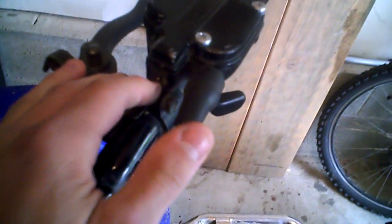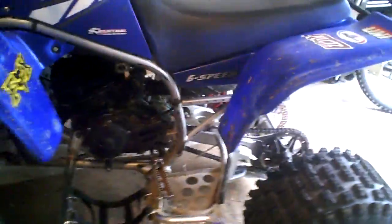Some other things that people do to clean up the handlebars a little bit is to get rid of that and the parking brake, and also clip those wires and clip the wires on top of the TORS. And what other people do is get the TORS removal, drill the hole out over there, and it gets rid of the whole system. So if you have an '03 and lower and it's not starting, check the TORS. Disconnect it mainly from there in the brain. Still not starting, move on to the next step.